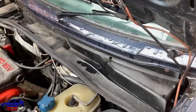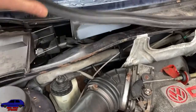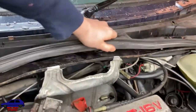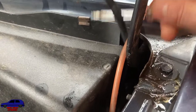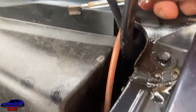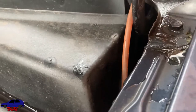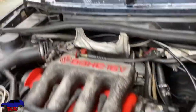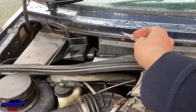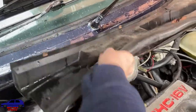To check that area we have to take out the scuttle tray. Remove these clips — they clip on the top. Remove this rubber strip all the way along. Be careful with these clips because they can break. Best to get a small screwdriver up and underneath, give it a wiggle and hopefully it should come off. Do that all the way along and remove the one, two, three clips. When you've removed all those, the scuttle tray should come off.